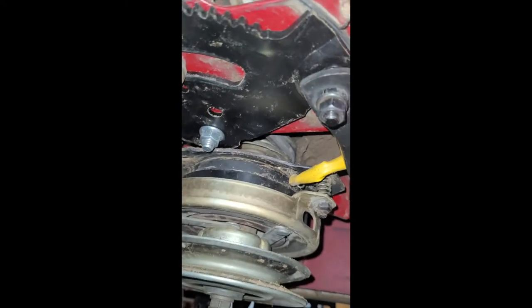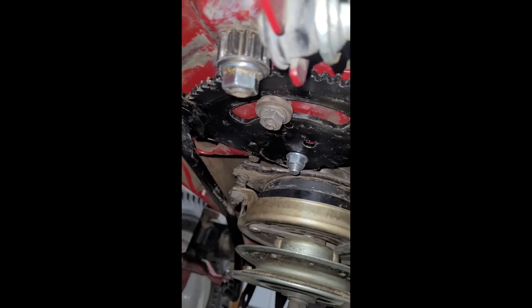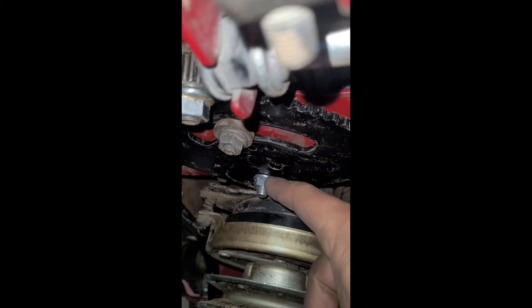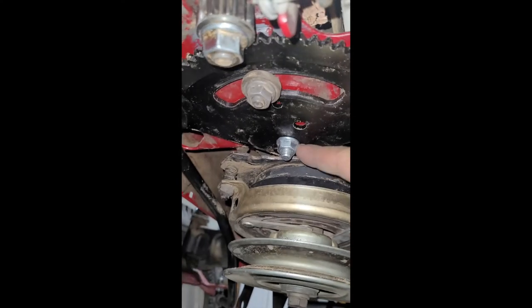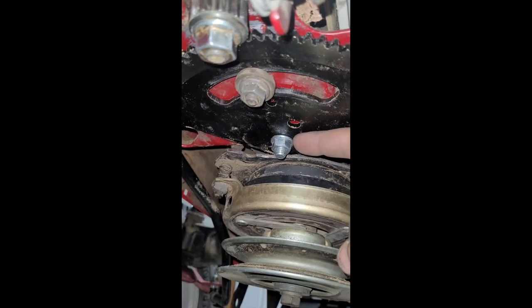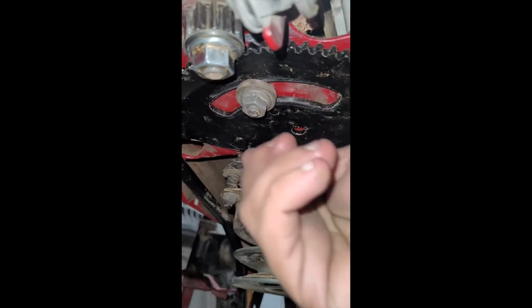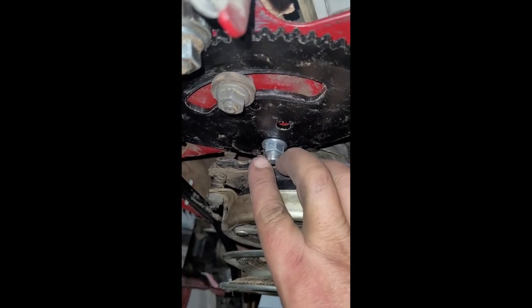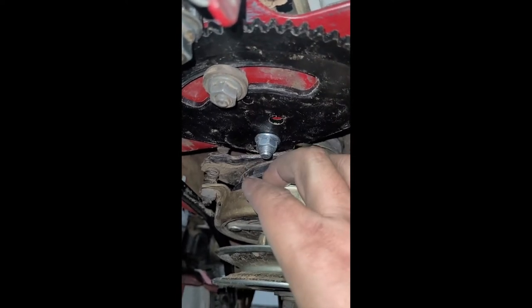You could see it would rock. But this bolt or steering up here, now that I'm moving the wheel from the top side, the wiggle in there has reduced to very little. So honestly, I think what we were looking at was a loose bolt right here. And I believe we potentially found out there needs to be a washer under that bolt as well. So that might come down and then right back up. To cinch that thing on, what I did was I took vice grips and I pinched it on these two threads here without trying to thrash them. That way this bolt can still come off in the future.